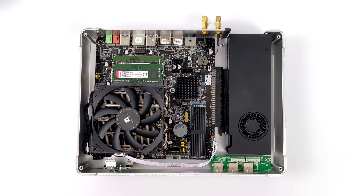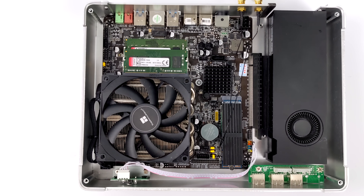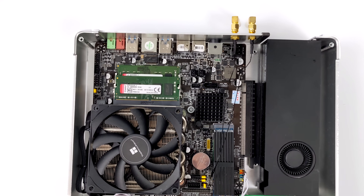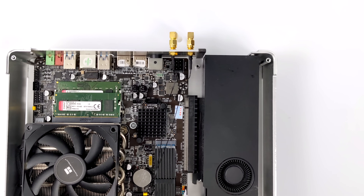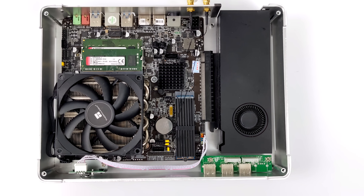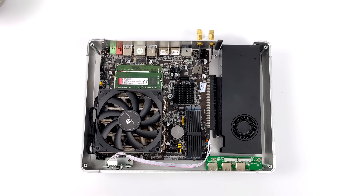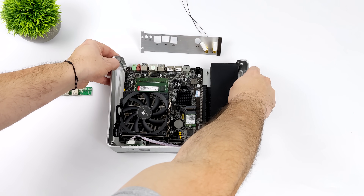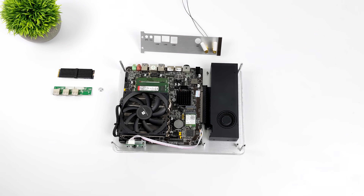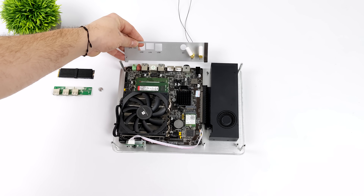The layout on this PC is very odd — the motherboard has a PCIe slot coming off the side of the board, and it only supports 9th gen Intel CPUs. Originally you could pick these up with an i3 or i5. I've upgraded the CPU to a 9600K, so we've got six cores, no extra threads, but a clock up to 4.6 GHz. The rear panel actually had to be cut to fit the A2000, but luckily it's soft aluminum so it went through really easily.